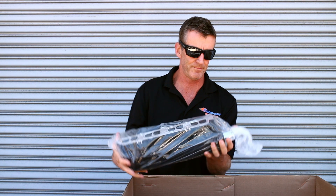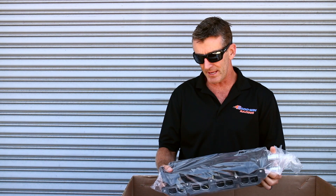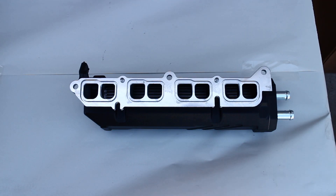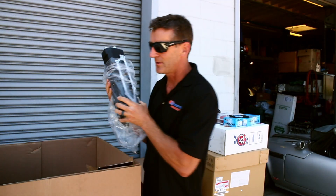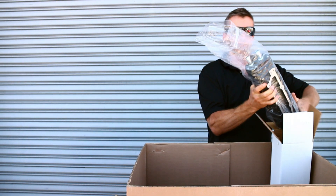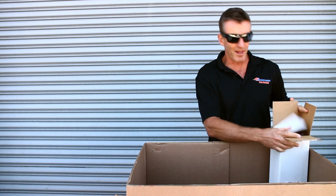This is your intercooler core. On the NC setup, we had one giant piece to put on the car that included the core and the blower. Here, they made the install a lot easier in the very tight space by having it as two separate pieces. You'll be able to see the intercooler core inside — and there's the engine mating side of it. Basically, the supercharger blows into here, this absorbs the heat, the supercharger is shooting straight through the core into your cylinders, and the result is the most direct, most instantaneous power delivery you're going to get with a boosted system. They could have gone with an air-to-air intercooler up front, but then you've got all that additional throttle volume and the air's got to travel all that additional distance. With this setup, instant throttle response that feels like a factory install, not like something that was bolt-on aftermarket.